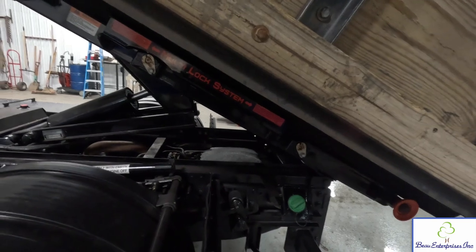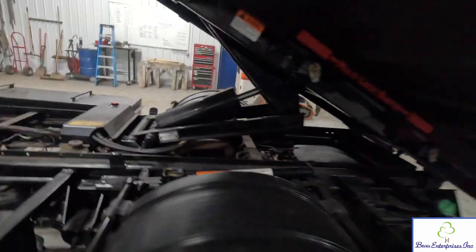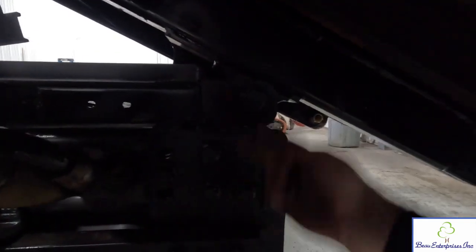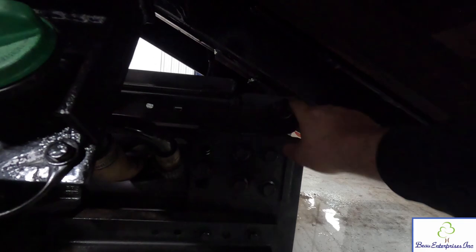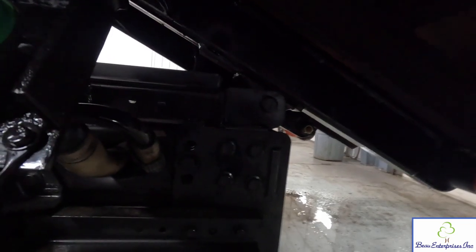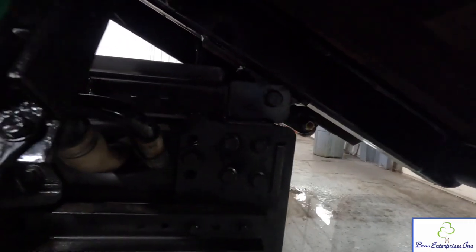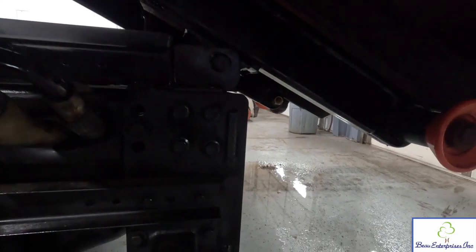Moving along — not a lot of bolts or drilling in the frame. It was only one bolt per spot. You've got one back here, two, three, four per side, plus the rear plate in the back. I did a bolt-on design as well — there are two bolts that come down from the top into this plate right here. Do that before you put the bumper on. You have to pull the pin out — on the other side there's a little Allen key and a cotter pin. You pull that out and actually lift the back of the hoist up. Hardware's going to be a little bit long. I found that this bolt right here and this bolt coming down run into each other, which makes it a little tough. Getting wrenches on the back of them is nearly impossible because there's not a lot of room — there's a gusset in there.